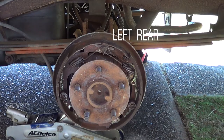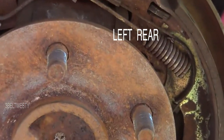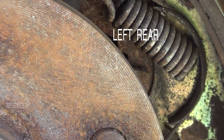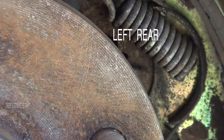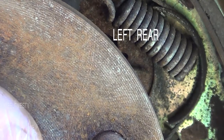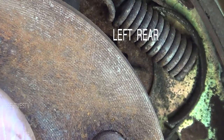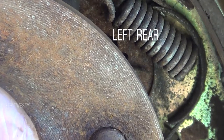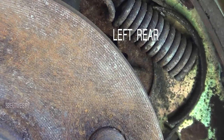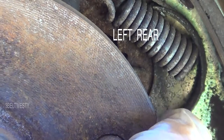This is the Ford 7.5-inch axle on the left side that was running cool, so the bearing is probably good. I just want to show the slop. I'm going to push the axle up — it's probably got about ten thousandths, maybe fifteen max. You'd want to put an indicator on there, but this has basically almost no slop compared to the one that's worn out on the other side.